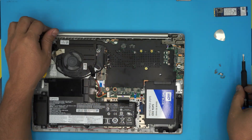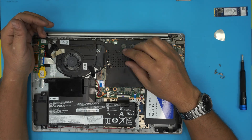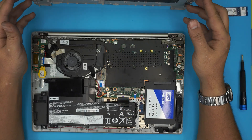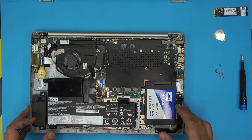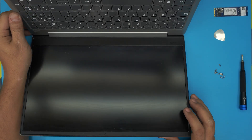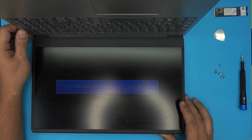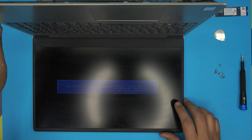Here's a tip: once you remove your RAM and put in new RAM, on the initial boot you might not get a screen — don't panic. Just power it off and try again. If it still doesn't work, remove the RAM, reinsert it, and try again, because not all the pins always make contact especially with new RAM. Before putting the bottom cover back on, you can run a test — plug the battery in, power on, and make sure you get a screen showing the logo. Your screen might go off and on, so wait a few seconds especially if you disconnected the battery.